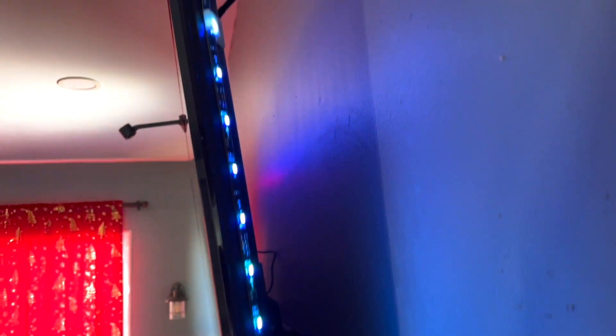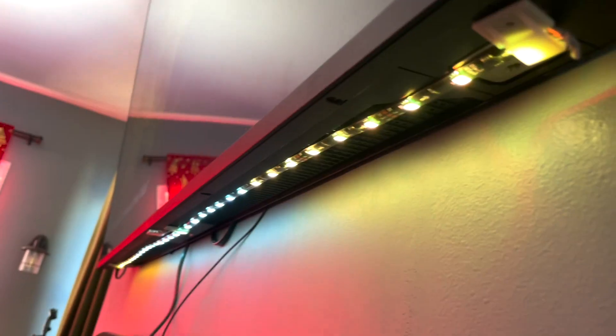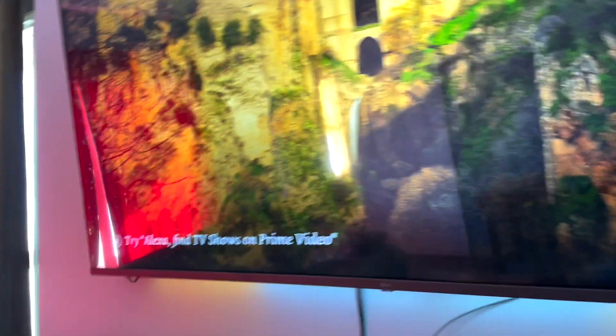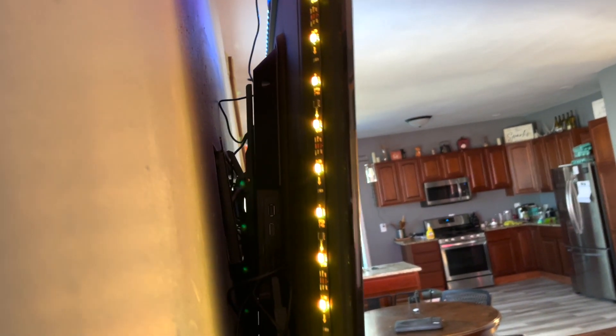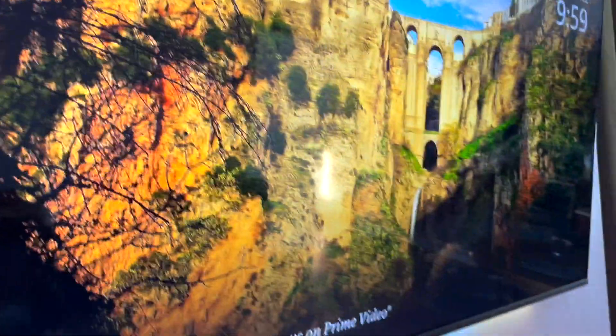Another thing I wanted to mention is make sure that you have the LED strips on the correct side of the TV. When I was following the instructions, it said to place it on the back near the bottom. Depending on the thickness of your TV, you might have to put it on the absolute bottom of the TV, not the back, or it's just going to cover up the LED strips, which you don't want. I lost a little bit of stickiness due to moving it a couple of times to get it right. Also, don't try to apply it while it's on the wall. I attempted that — it didn't work out great. I just removed the TV, laid it on the couch, applied it to the back, and then put it back on the wall.